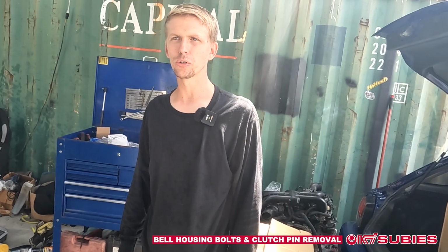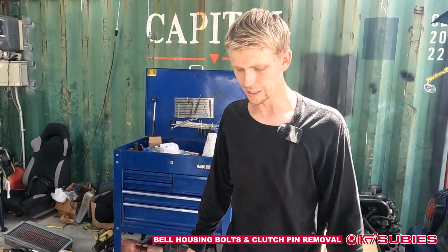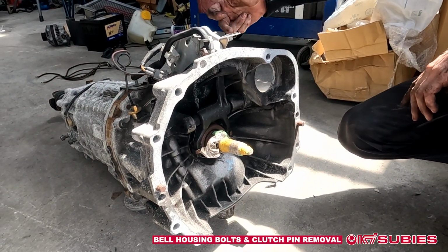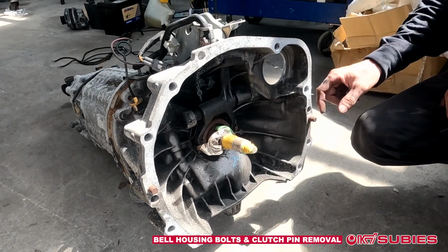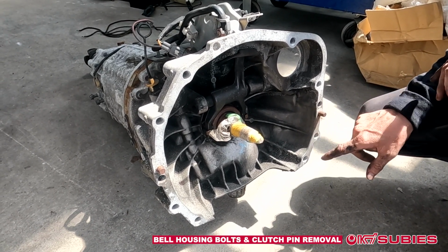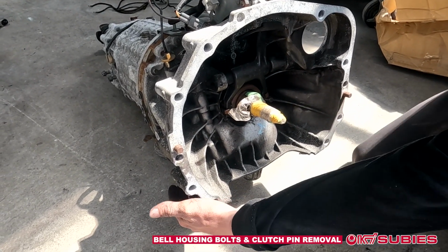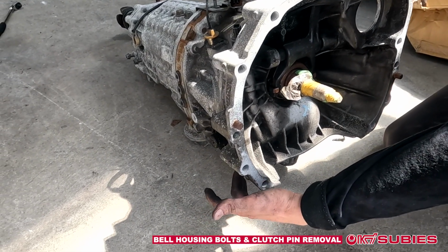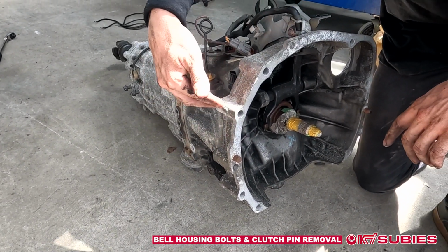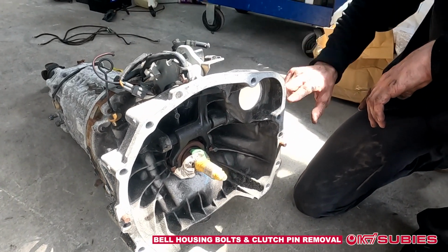To save time and not to be so close up on all the bolts, we'll just show you on another 6-speed transmission where they're located. On the top where the starter is bolted to the transmission, there's two that come through here. So 1, 2, this one is not used, it's for a dowel pin, right above the dowel pin. There's another bolt right here, and then there's a stud. The stud is located on the engine and slides through the bottom here. So there are going to be nuts on the back side, normally a washer and a 14 millimeter nut on the bottom. And then as you work your way up, a 14 millimeter bolt, 14 millimeter bolt, 14 millimeter bolt. This is not used. And then on this side for the starter, 14 millimeter bolts.